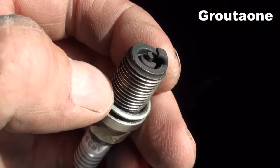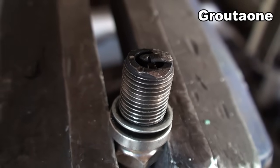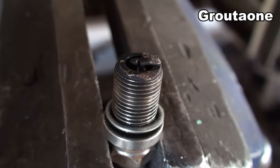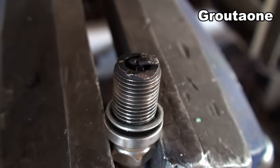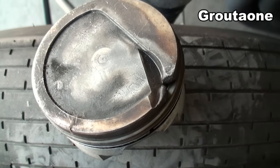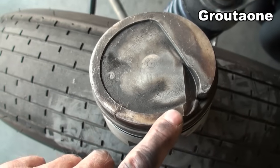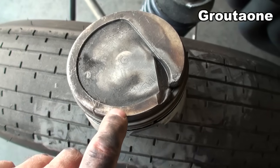This plug doesn't look like there's a reason why it wouldn't fire, but if it's got damage on it — I just took a hammer and beat this plug up to show you — if you ever have a plug that looks all beat up when you take it out of the engine, that's a good indication you need to pull the head off and look at that piston or any other damage, because something has come loose and beat it up. Usually it's part of the piston that's come off. You can see a piece missing out of the corner there. Sometimes a big piece of the ring land will come off, and it can be a variety of reasons: the air-fuel mix, the timing, and sometimes even the ring gap — not enough ring gap.